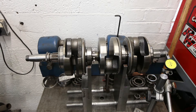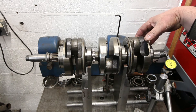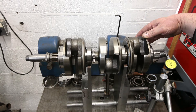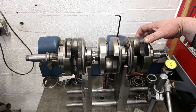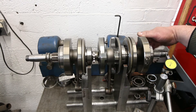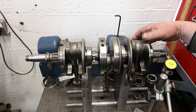Hello John, here's a quick look at your crank up on the stand now. The problem we're feeling is this main bearing. If you can see the clock, that's the roughness you're getting there. Bit of run out and that's the kind of bump bump I'm feeling in the cases as I turn the crank just there, see.